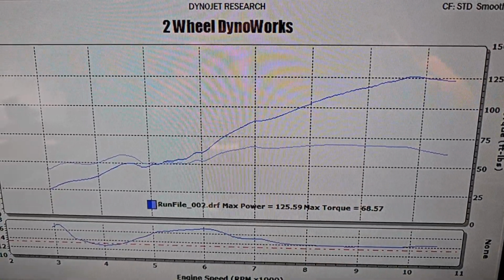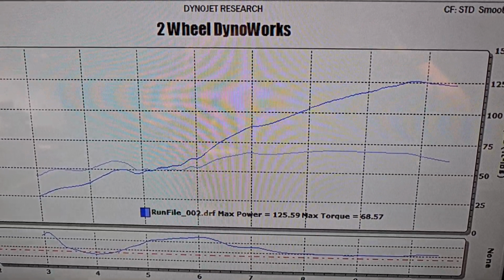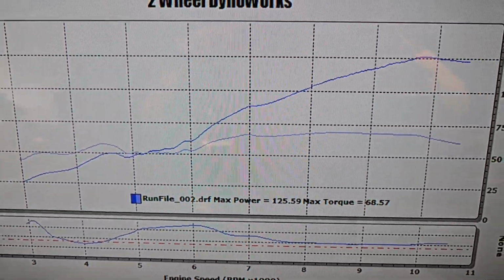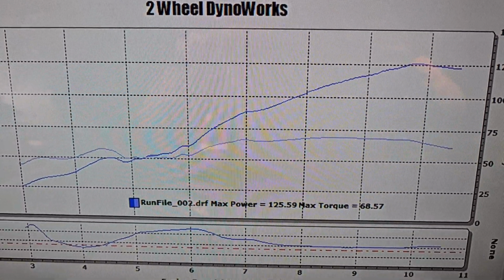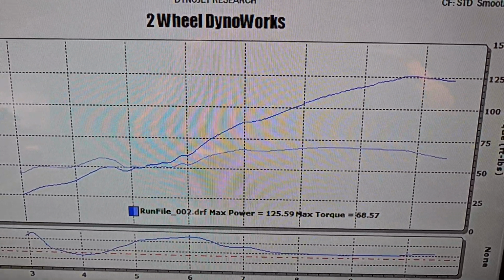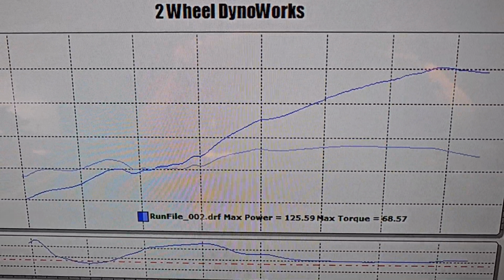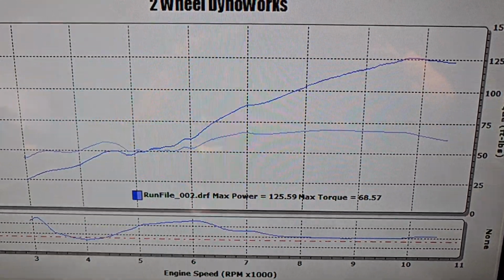Here's what I'm talking about. This is how this bike came in with the stock mapping still in place in the ECU and the full Arrow exhaust system installed. You can see down there that the AFRs between 5,000 and 7,000 RPM are nearly off the charts lean. There's 17 to 1 AFR at a certain spot there, right about 6,000 RPM, and the bike just barely runs. It spits, it sputters, it's all kinds of pissed off. It runs hot as hell, and even once it finally gets back to reality, it's still 10% too lean, way out there at the top end of the RPM range.